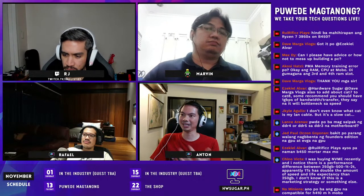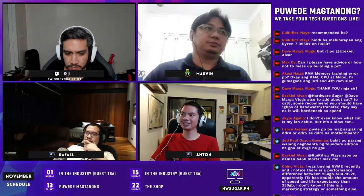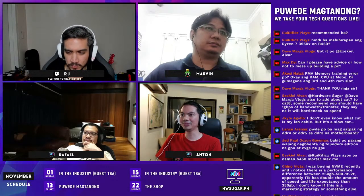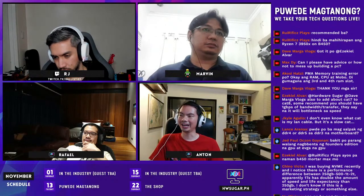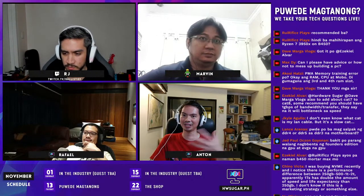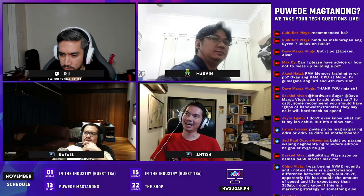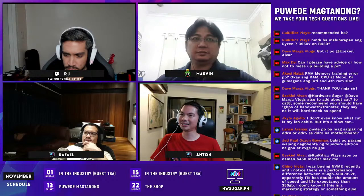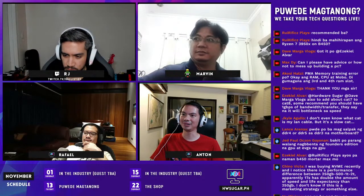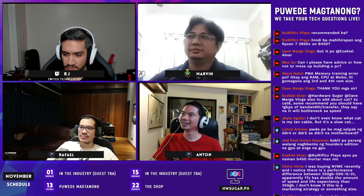And it depends on the case. Sometimes the case really can't fit it but you want an AIO. No problem with that, I mean, it's personal choice. But just in terms of performance, if you only have space for a 120mm RAD, I would just really go with a good air cooler rather than a 120mm RAD. And that's regardless of whether it's the M22 or the Deepcool L120, I think is what they call one of their 120 AIOs. The performance just really isn't there for a 120mm RAD.